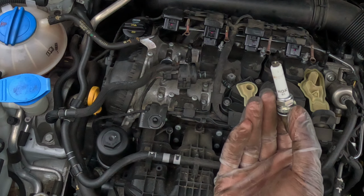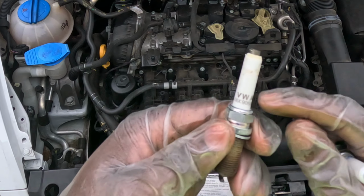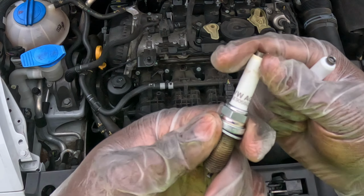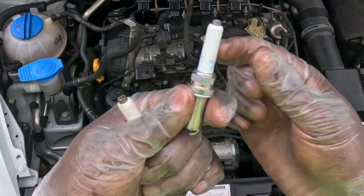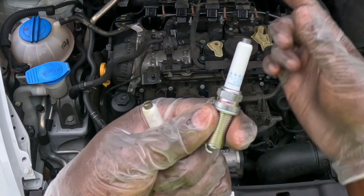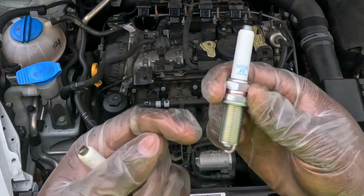All right, let's compare our parts. Okay, let's talk spark plugs here. Just so you guys know, see how this says Volkswagen? Volkswagen doesn't make spark plugs, you guys. This is an NGK, just so you know. The actual OEM spark plug is an NGK Laser Iridium. I'll put the part number in the description. But make sure you get the OEM. Do not get anything different.